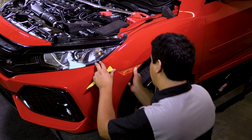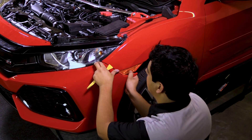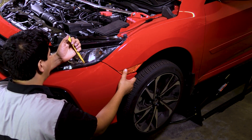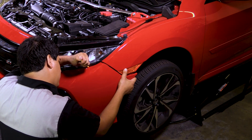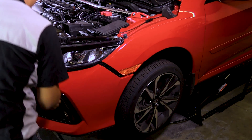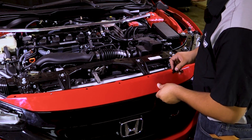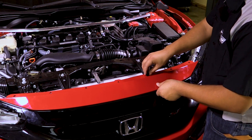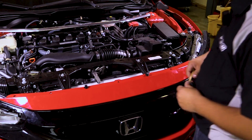Now grabbing the edges of the bumper, we're going to start off on the driver side, pulling the bumper away from the fender and releasing the clips holding it in place. Once you get to the headlight portion, there are some clips you want to be careful with, so take your time and use a non-marring pry tool or maybe a long flat head screwdriver to release the clips. Before you completely release the clips on the bumper, you might want to set some of these in place on the top to keep the bumper from falling off completely.